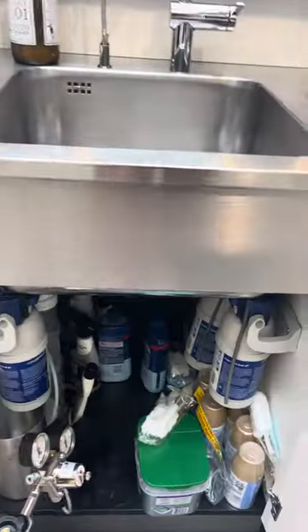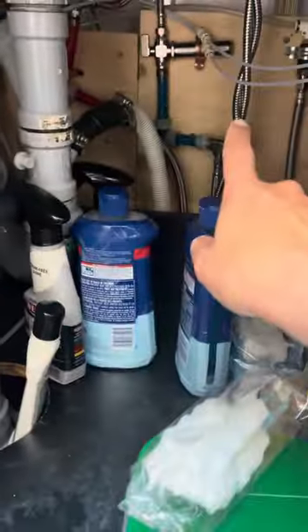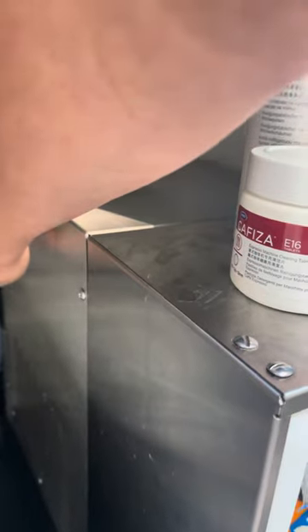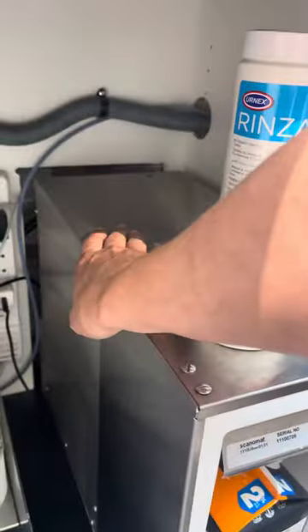And what you have to do is, at the same moment, you turn off the gas and the water valve. Then quickly you turn on the cooler or the ice bank fridge — you power on — and you will hear the compressor starting.